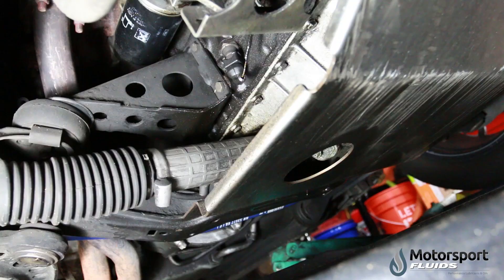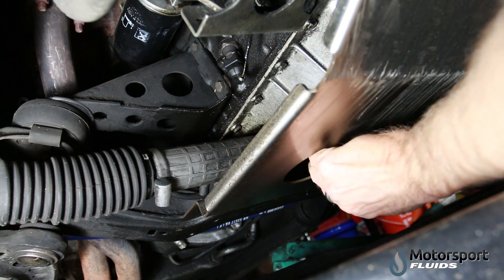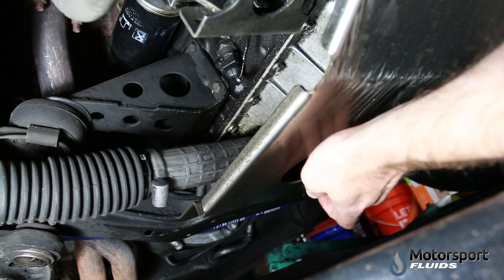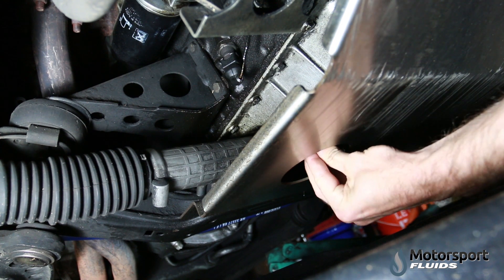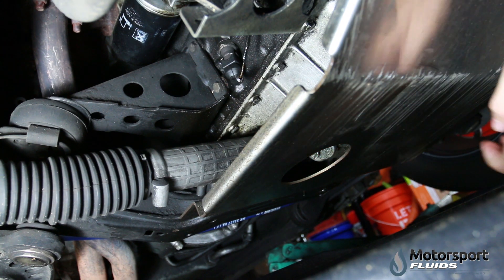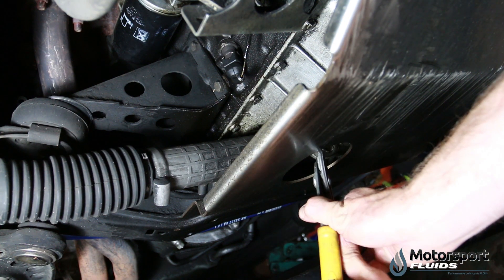Car's all jacked up, I'm going to get down underneath here. You can see right here — here's the stock drain plug. It's kind of set up for your fingers, which is actually kind of cool. I'm going to try to untwist it by hand. Oh my god, it's tight. Okay, let's get some pliers on that bad boy. It's freaking tight but now we can drain out all the old oil.